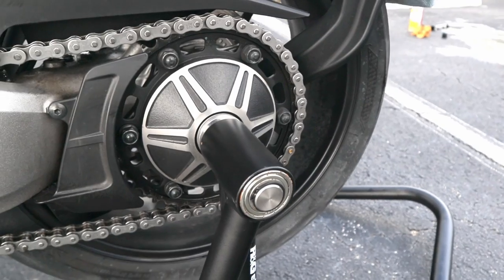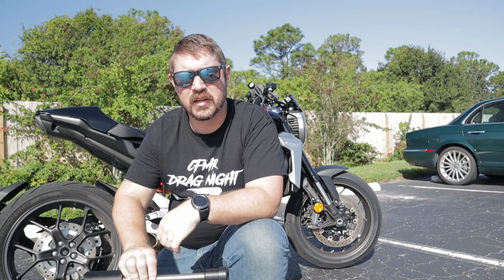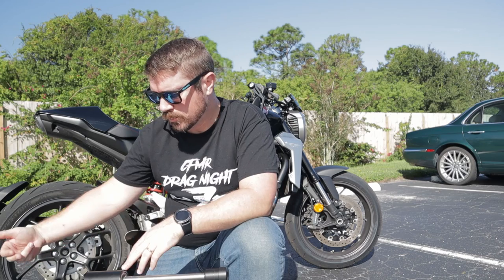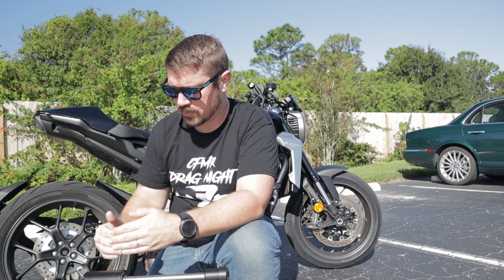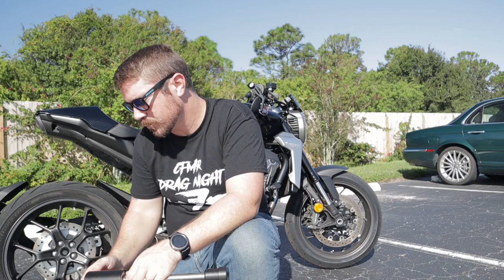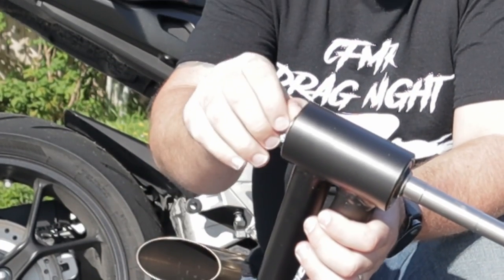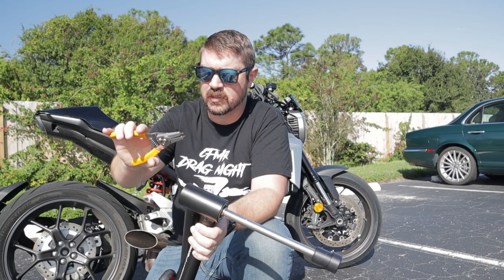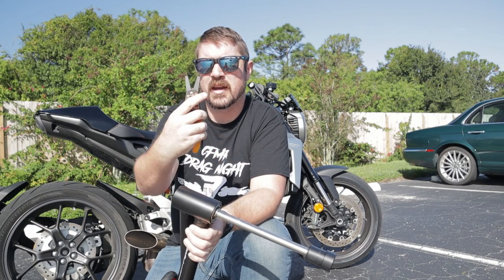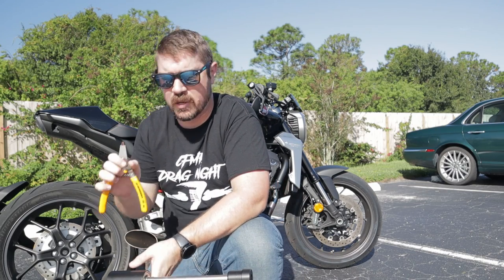But the individual welds are really great. The shaft that actually goes into the rear wheel comes in a separate box that you install from the outside inwards — it will not go the other way because it's slightly tapered. Then there are two ring clips that you have to put on, one at the front and one at the rear. Pretty easy to do — just get yourself a set of ring pliers set to interior so it expands and it just slips right over. You're going to need a pair of these; you're not going to be able to get those ring clips on without them.